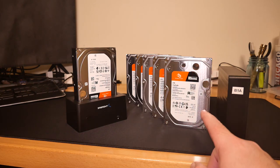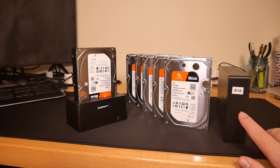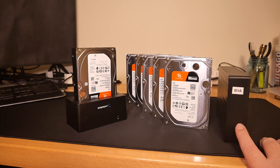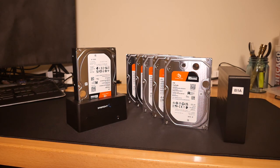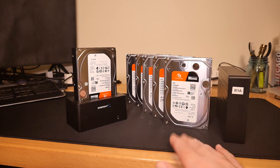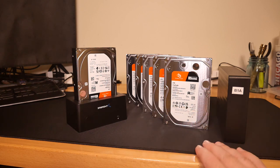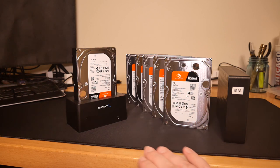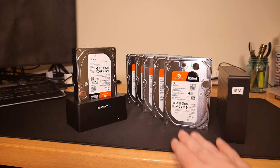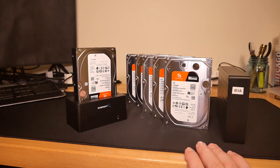That's the point of the video, and you can save as well. When you buy pre-encapsulated drives you never know what's going to be inside them — at the time I bought those there's allegedly a pretty high quality drive but it's still a slow archive drive. These drives I was able to spec out myself: they're all 7200 RPM, which means for hard drives they're pretty quick. Most importantly they all have a five-year warranty. In my experience above anything else, it doesn't really matter what manufacturer — always get the one with the five-year warranty.